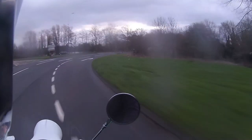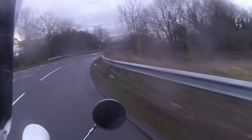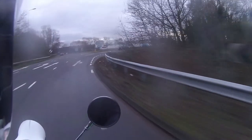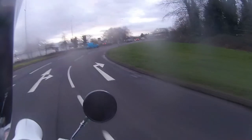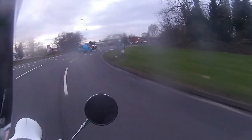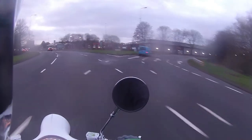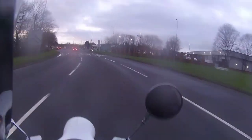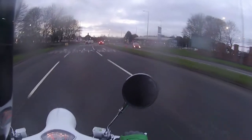So we ride test for around about 20, PDI, QC, bolt checks, and we repeat those twice. Final bolt checks, absolutely everything. Two lots of ride test mileage as well. And the simple reason being, if we find an issue on the first ride test, then it gives us time to get on to Lexmoto and order the parts in, or go hunt in the stock room and see if we've got a new part in our stock room.